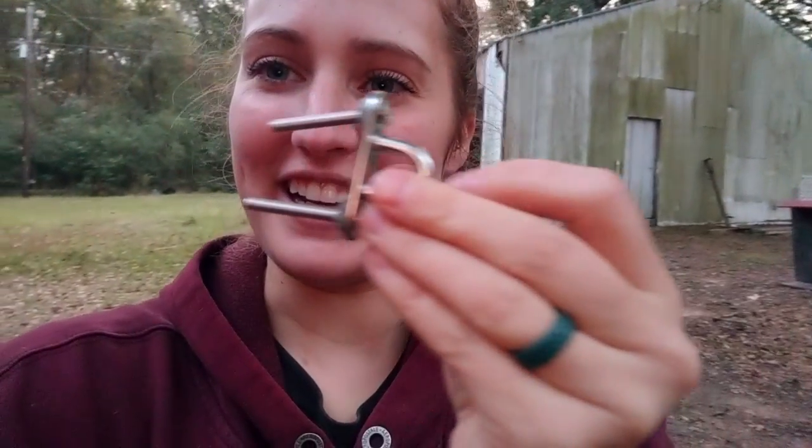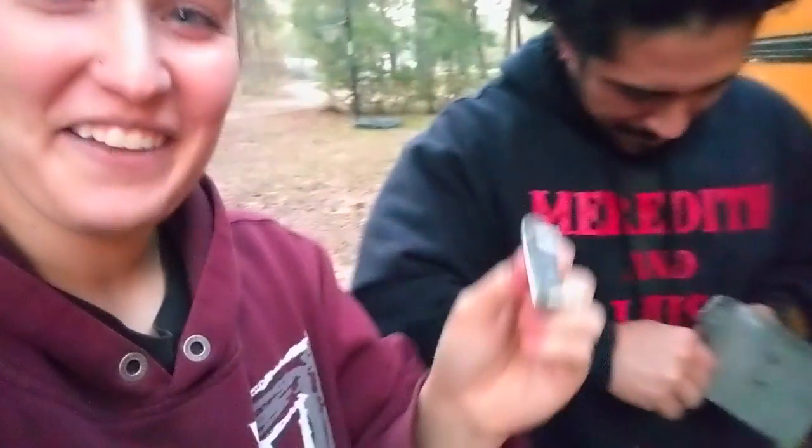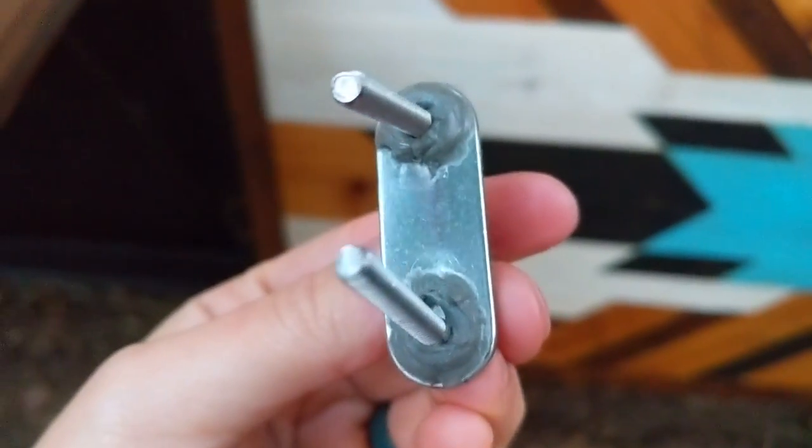Loved using the Butyl tape for the windows and then the roofing tape with the Butyl tape on it for the hatches. We just felt like it gave a really good seal. So you might have seen when we did the side doors with the locks, we don't have any just Butyl tape, but we still have a huge roll left over of the roofing tape. So we painfully scrape off the Butyl tape and put it around the edge and then put the lock in so it would have a good seal. And now we are doing the same for these that are going on the side of the bus. It's not easy to get it off, and it sticks to everything, and it's very difficult, but this is the end product.